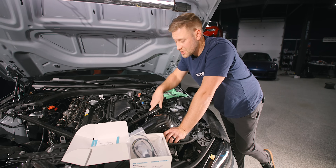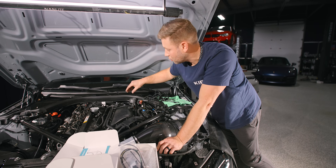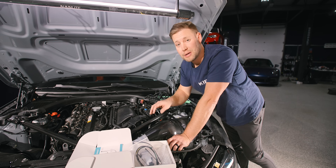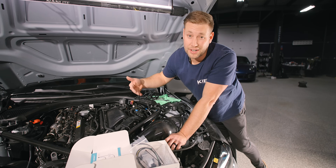At this point, the fuel line and sensor are fully installed. After your installation, go back and verify there's no leak over here or here. That's why we're not going to put the engine cover back on right away — you always want to make sure that you check for fuel leaks. We've never had an issue with a Dorch kit, but you always want to be extra careful because you are dealing with fuel in a very hot engine.